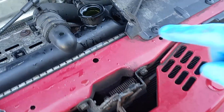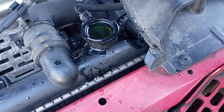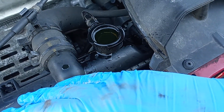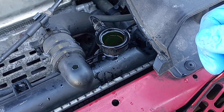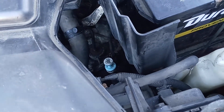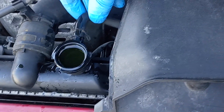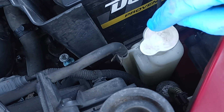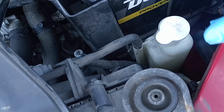When you fill it up, remember you already have coolant inside the engine, so don't worry about that. That's why I say sometimes it's best to just drain the radiator by itself — if you turn on the engine first, you'll need more than one bottle. Also check your reservoir and make sure you have antifreeze in it. Don't fill the reservoir all the way to the top; leave space, because if there's too much in the radiator it pours back through the hose into the reservoir. Just half-fill the reservoir, and if you already have coolant in it, leave it.